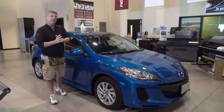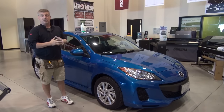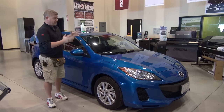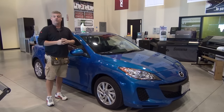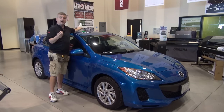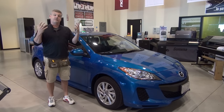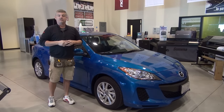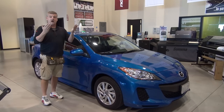I'm just going to quickly review the starting procedures, cleaning, as well as application. We would obviously ask this customer to bring the car washed, soap and water, no lanolins, no waxes or any kind of additives like that, just plain soap and water. We're then going to follow this up with an isopropyl wipe, which is a very mild solvent. We use 99%. That way we can make sure it evaporates very quickly and we wipe up any residue very, very fast. I'm going to always start from low and work high, okay?